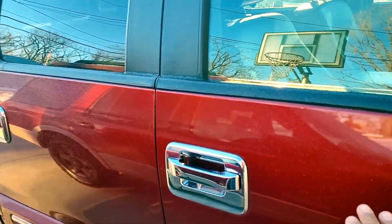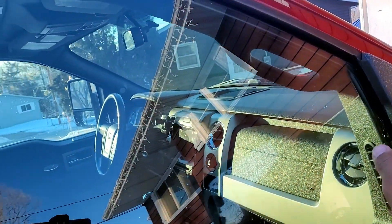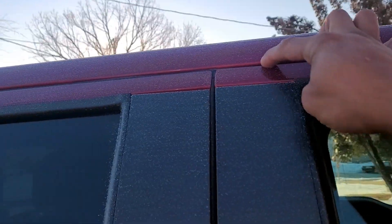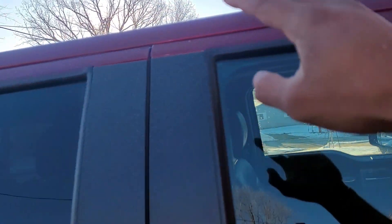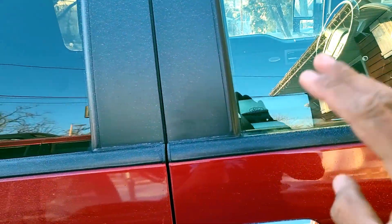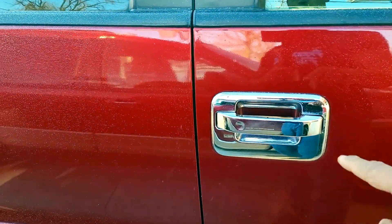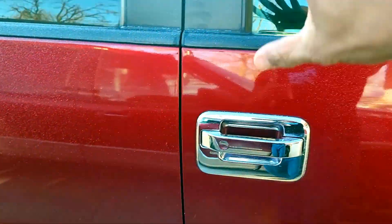Come over here and take a look at this. We got frost on the door still — it's negative 8 degrees, frost on the mirror. What happens is moisture can get in between the door and the frame, get past that gasket that's in there and actually sit. So when you come in the morning to open your door, it's freezing out — you're running fast, you want to get inside, get your car warmed up. You go and grab your door handle and it's stuck. Because it's frozen. Moisture got in between the door handle and the door jamb and it froze overnight.